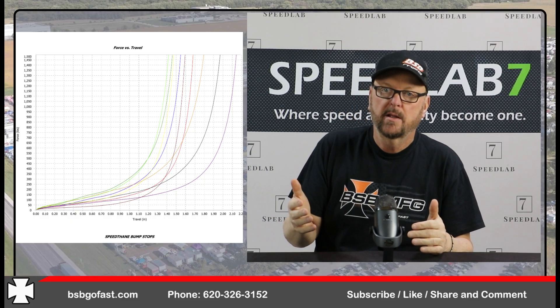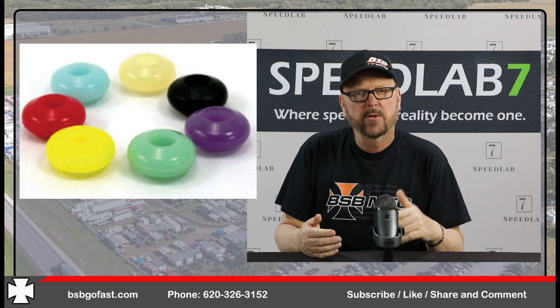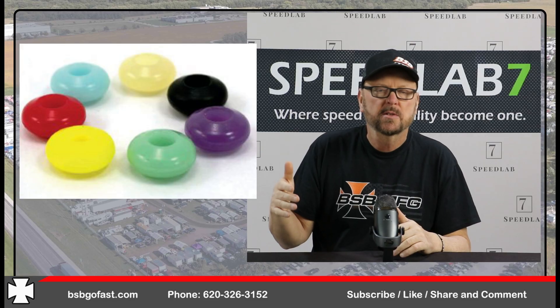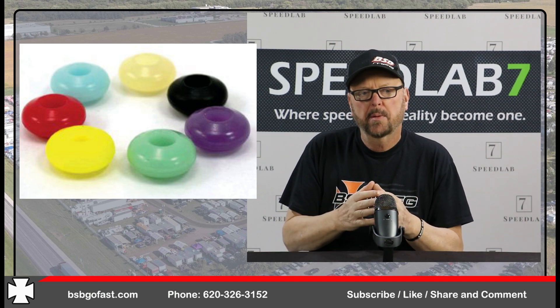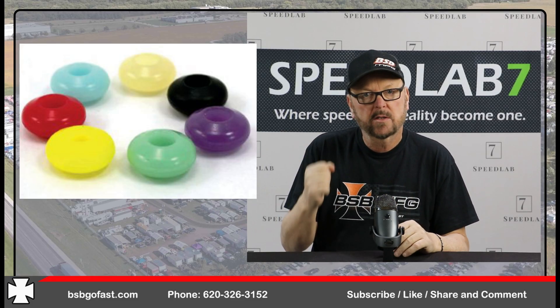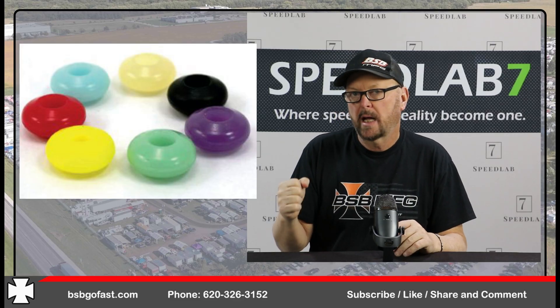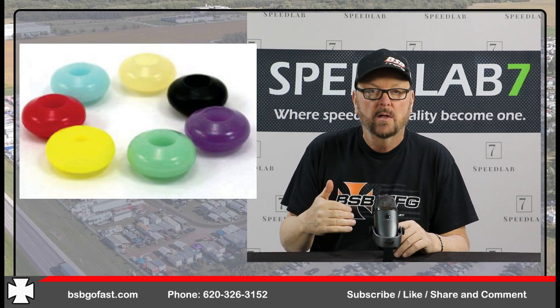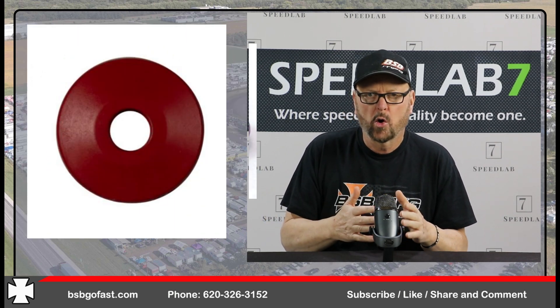The second type of bump is a polyurethane bump — roller skate wheel bumps, donut bumps. A polyurethane bump is very hard and sees very little travel. This type of bump isn't made to have much compression in it like the foam. It's made to get right to business and may get into a load very quickly — like a hundred thousandths of travel into the bump. In my opinion these are more complicated; sometimes you can stack them and create different loads. Currently in our crate late model and late model racing we're using a bump similar to this — more of a hard rubber — just to create end of travel.